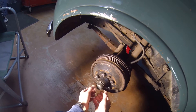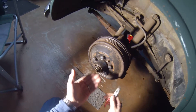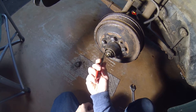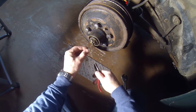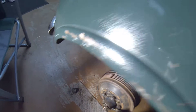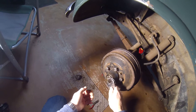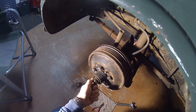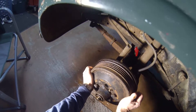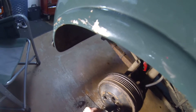I've already got the wheel off here. This is the grease cap - you just pop that off with a screwdriver. I usually lay down some kind of mat and lay my parts on it. This particular wheel has been dripping brake fluid all winter. The cotter pin - I don't reuse cotter pins generally, always throw them out and put new ones in every time. Pull that out and lay it down. This should be loose already. Crescent wrench or something like that. Pretty simple - undo the nut. When you put it back together you only put a couple of foot-pounds on it, then put a cotter pin through it. You've got a washer here that fits in the slot of the spindle - see it's got a groove in it.